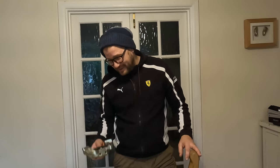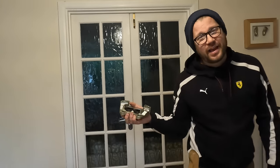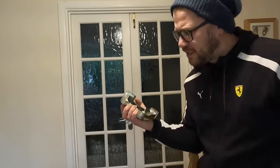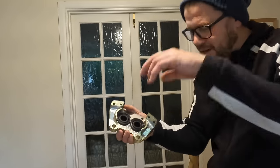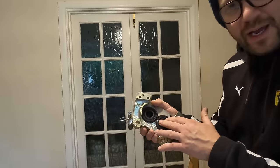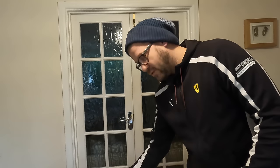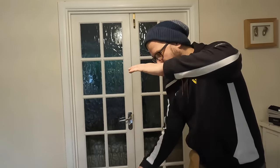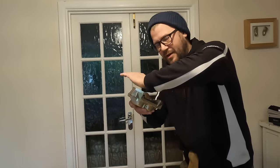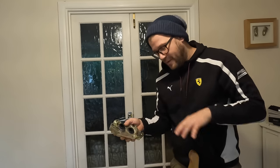So I'm a few hours in already, and this is not an easy job. When you think these things are going to be 5 minutes in your head, they take blooming hours. Anyway, some of them are going in okay. Some of them really don't want to play ball. Look at that, I'm getting a big bruise there when I'm just trying to push these pistons in by hand, literally by hand. It's helping having these calipers in half like this, but about 50% of them just don't want to go in.